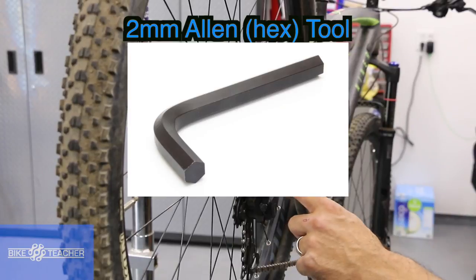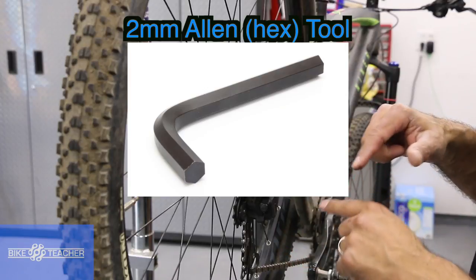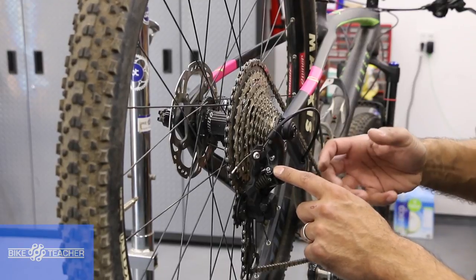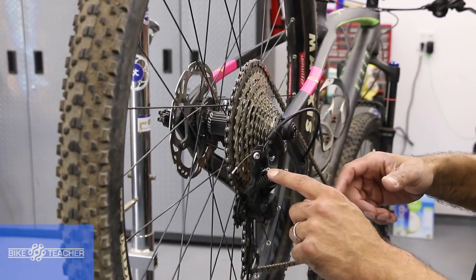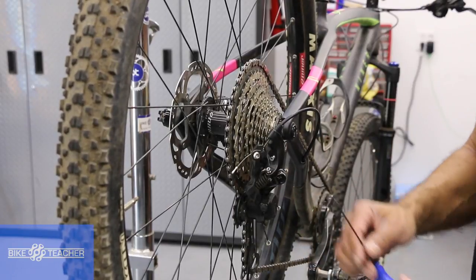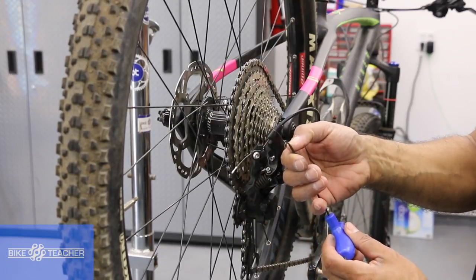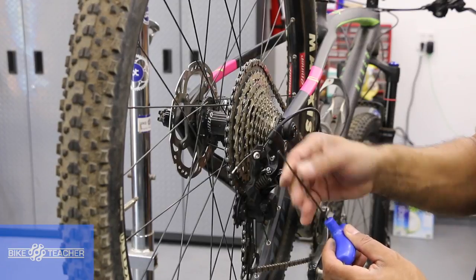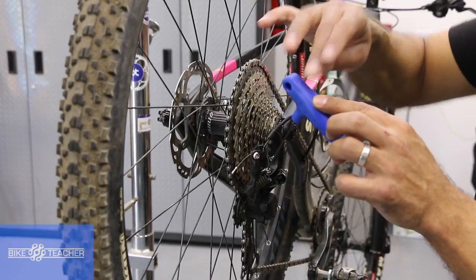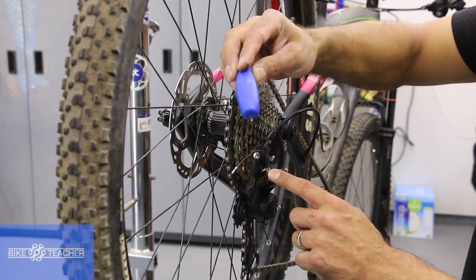You could say it's in the middle — we've got a screw here, screw here, and another one there. These take a two-millimeter Allen wrench. Don't get confused with Torx — both can fit each other, but at some point it's going to slip and you're going to strip your bolts and wear down your tool. So these are two-millimeter, and if you have one — I have a ball-end here, but I have an old one where I sanded the ball-end off so I just have a flat piece, because ball-ends don't always have the greatest fit. They allow you to come in at angles, but I need to come in straight and get as much tool material into this bolt as possible.